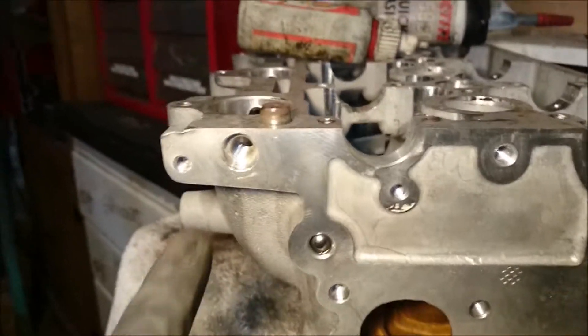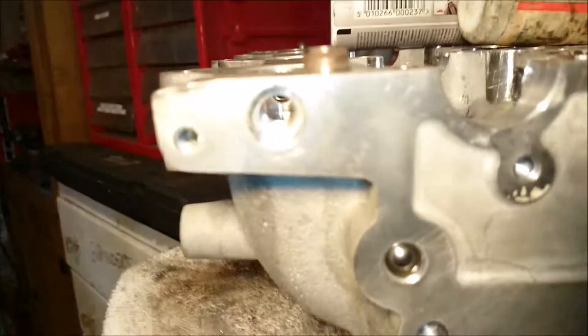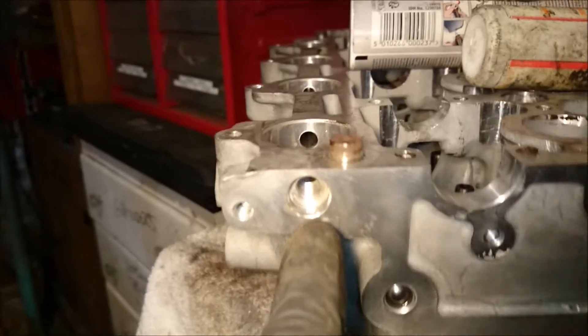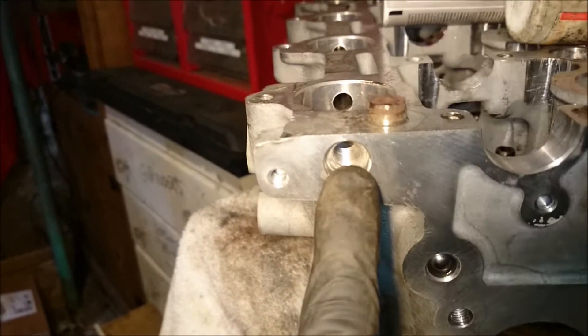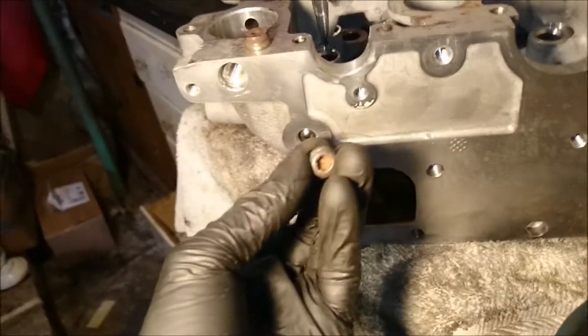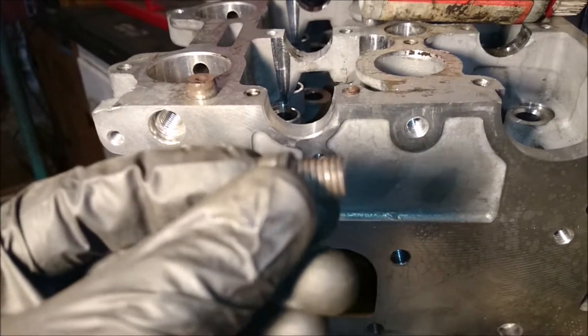On the 16-valve heads, on the end is where the shaft goes through - that's where these flaps go in - but we're not using them. So what I'm going to do, and have already started, is drill this out to just under 9mm and then tap an M10 thread in - M10 by 1.5. I've then cut down a bolt to exactly the right length; the head was a bit big so it needs to be a flush finish, and then I'm going to jam a load of sealant and thread lock in there, with a little rubber seal on the end as well.